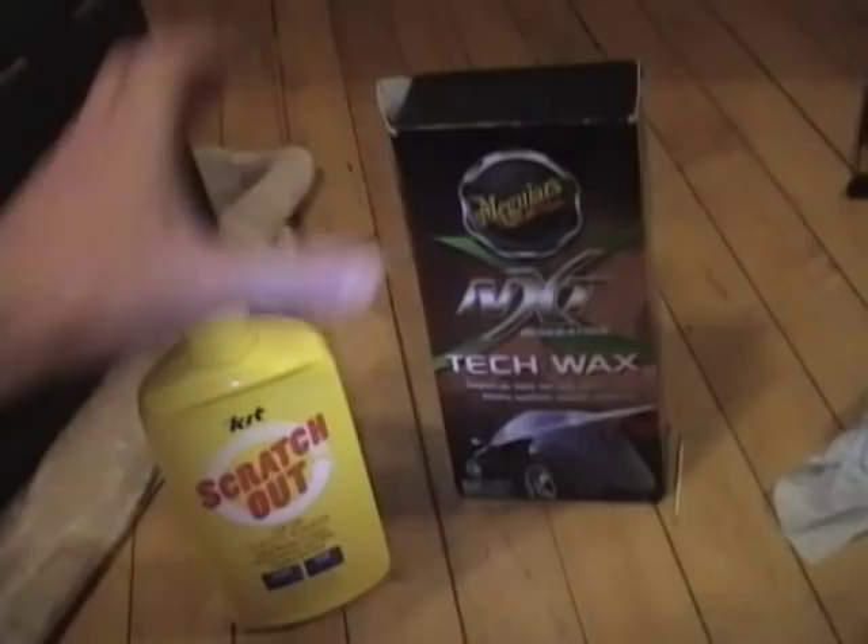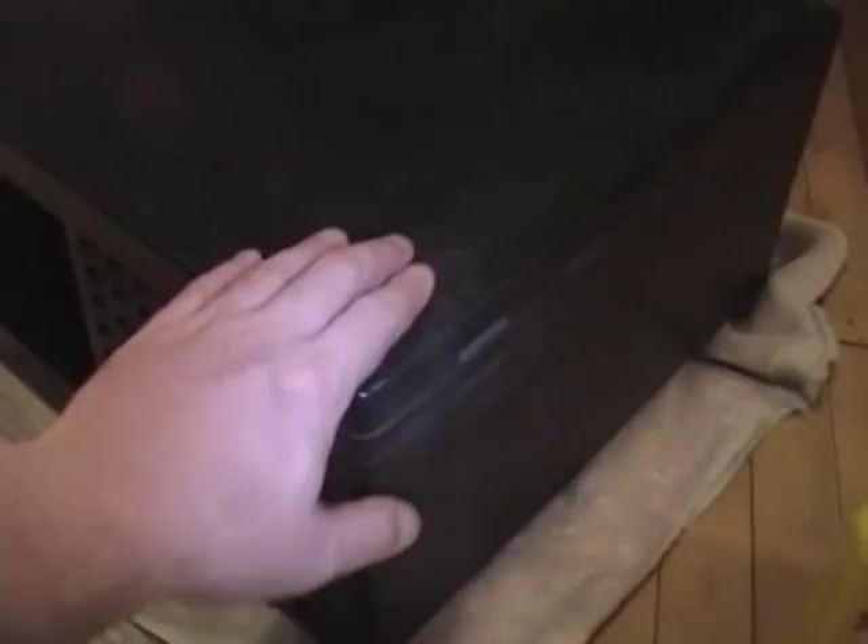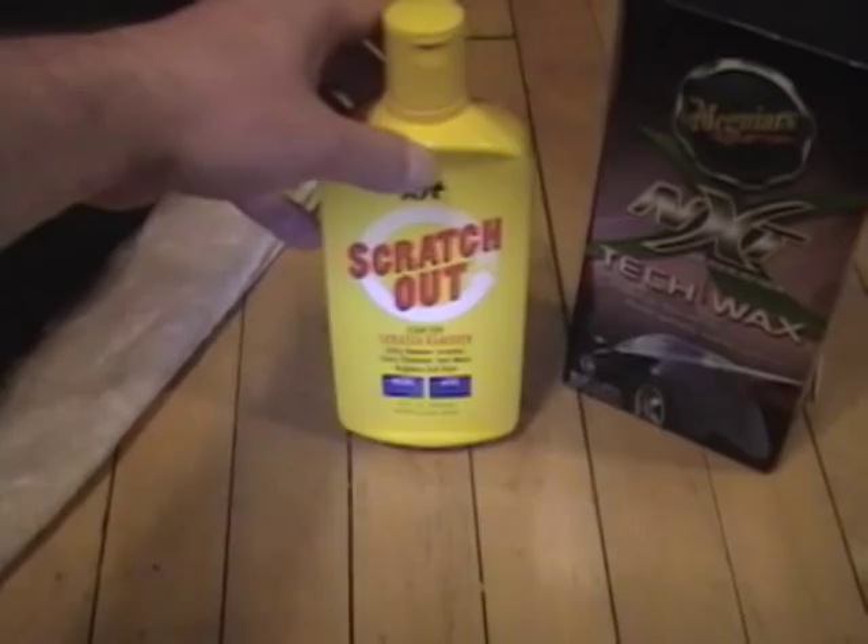Similarly, Howard's Feed & Wax is actually for wood furniture but you can put it on Bakelite too. My problem is that Bakelite is really chemically resistant, so any oils and waxes just sit on the surface, making it a little sticky and attracting dust — but it does look alright. Then there are actual car wax products like Meguiar's Tech Wax, which work pretty good. They'll do a better job on rougher areas because of the buffing action, especially something like Scratch Out which has abrasive and helps work out some of the roughness.